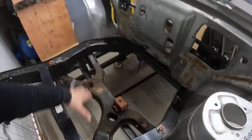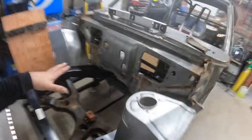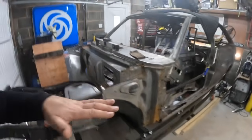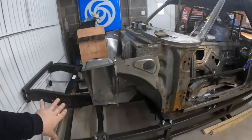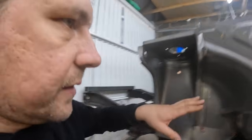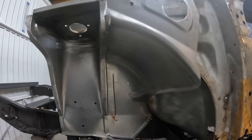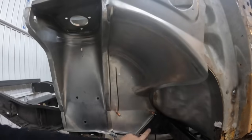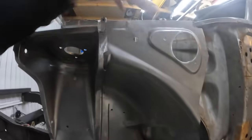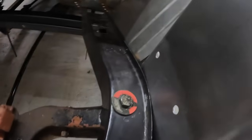The subframe needs new fixing rubbers as they're quite worn, but it doesn't matter at this stage - all I need is for it to give me the width of the rails. With that in mind, we went ahead and ordered TR7 inner structure front wheel arches from Robsport International. The TR7 inner structure onto the Marina body shell fits really nicely at the moment - I've just cleco'd them in to give an idea. Basing it on the datums of where the inner structure meets the existing chassis rail, it's not bad, it's pretty good. The only thing I'm finding is that the tower structure is a little bit off - there's a bit of a rounded rail issue there.